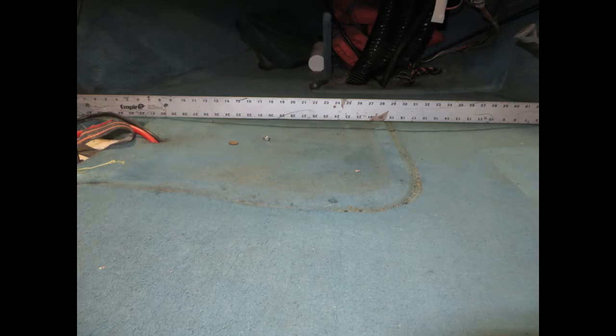If you have an American Skier Advanced Model where your dash is sagging and doesn't appear to be level across the top, it's because the load of the dash is transferred through the L-seat and into the floor, and the floor is actually sagging. It cannot hold the weight. If you put a straight edge across your floor in the L-seat area, you'll notice there's a pretty good drop there, and if it exceeds a half inch, it should be addressed.